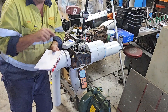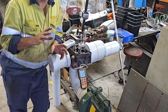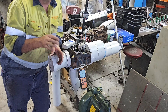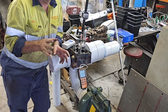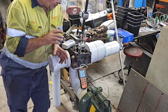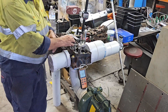At 600 lift, the intake should flow 191 CFM and the exhaust 172 CFM. The reason we're testing at 600 is that at 600 the flow is dictated solely by the port - under 0.25D (0.25 of the valve diameter), the valve and seat heavily influence flow. Once we get over that, the port is what it's all about - the valve becomes pretty much irrelevant to the high-level flows.